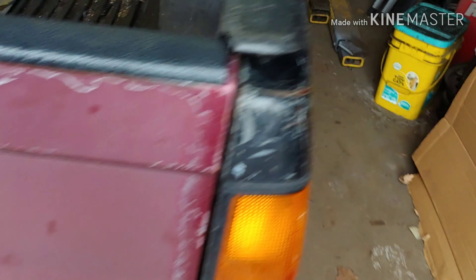I was making some suspension noises when I was driving it around. Have to see what's going on. There's something going on back here and something going on in the front. Probably ball joints in the front. I think it's the leaf spring bushing in the back. We'll see in a minute.